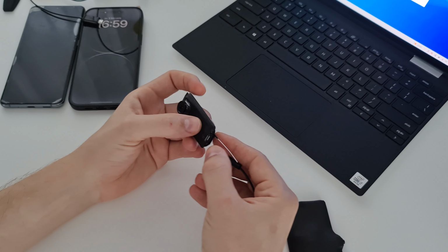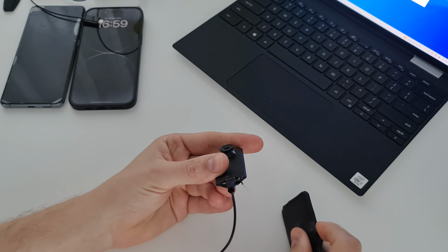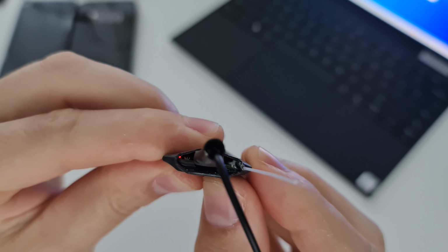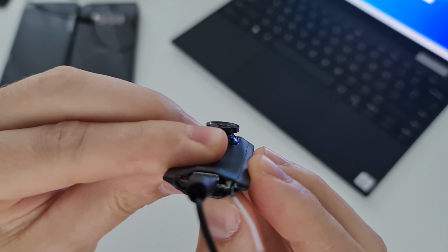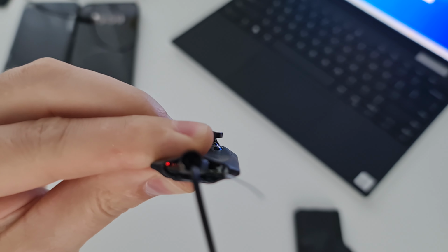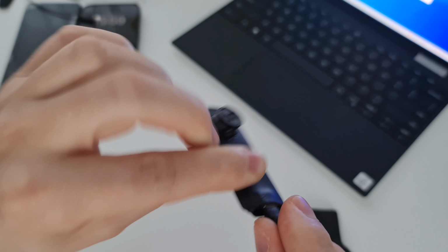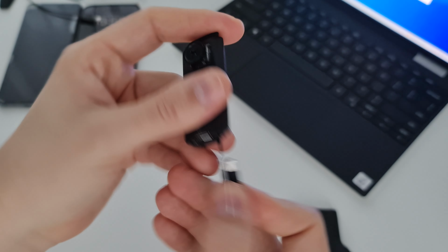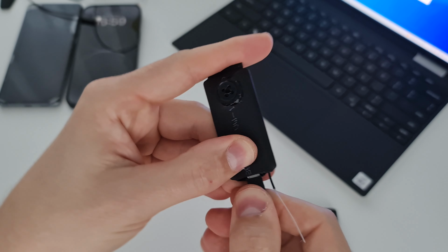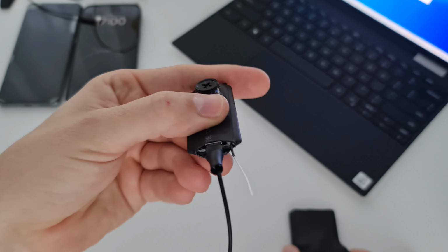When you connect the camera to power and start the power, you have to check that a red light starts lighting, and after 5 seconds, a green light must start flashing. If the green light does not start flashing, you can try to turn off the camera, remove the cable from the charging port and from the camera, and put it back. Press the connector in and check that it is fully inserted in the camera, and start again.